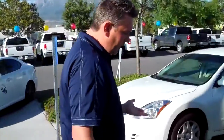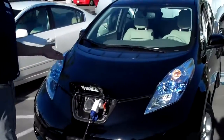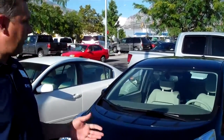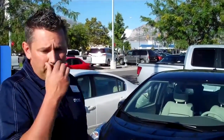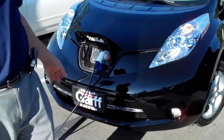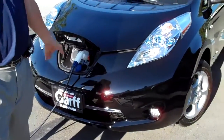Keep in mind, most of the time you're going to be charging from probably 50% to 100%, because the range of this car is 100 miles. And 95% of Americans commute less than 100 miles a day. So you'll realistically be going from 50% to 100%, which means on a trickle charger that would be about 8 hours — which seems kind of crazy, until you get wired for our 220 charger.